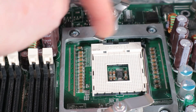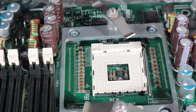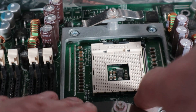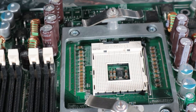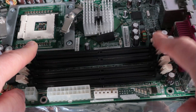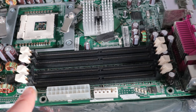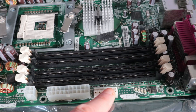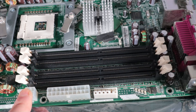Here is the socket. It's got one of these funky clamp things that I've seen on a few other IBM motherboards. I think they were fairly standard on IBM boards back then. We've got two banks for DDR memory. We've got an ATX power supply and we've also got an AT style power supply which I think is just to provide extra power to the PCI bus - I'm not 100% certain about that. If anybody knows any better please let me know in the comments.